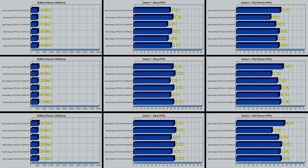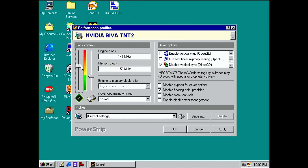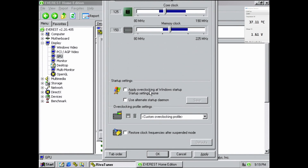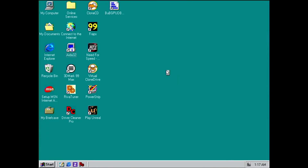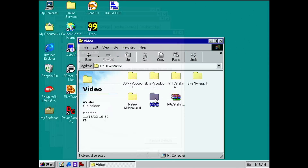Here are all the results on one page. There are a few overclocking tools you can use. The first is Powerstrip, which will probably work with a wide variety of cards including ATI and Voodoo cards, and also provides the option to enable or disable vSync. Another tool I like to use for Nvidia cards is RivaTuner — it provides a lot of information about the card, allows you to increase the clock frequencies, and lets you control the vSync option. If you don't want to use any third-party application, you can use the Nvidia driver control panel. Unfortunately, this only works with drivers later than 2.08 and you need to enable it by adding information to the Windows registry.